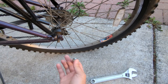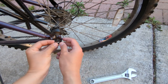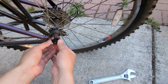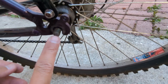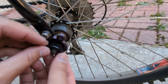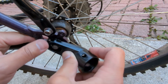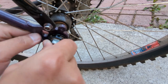There's no washer so the coupler can go on directly. There's a tab here, so make sure you place the tab where the opening is. Down here there's an opening where the axle stock can come out, and this tab is for that opening so it doesn't come off. Now you can place the attachment over so they kind of stick together, and now the nuts can go on.